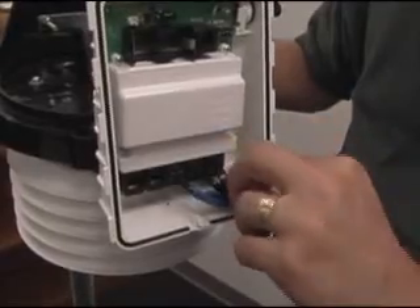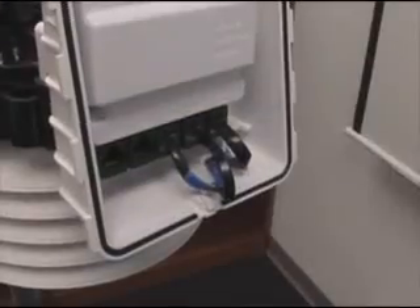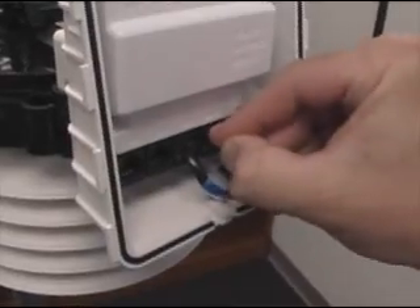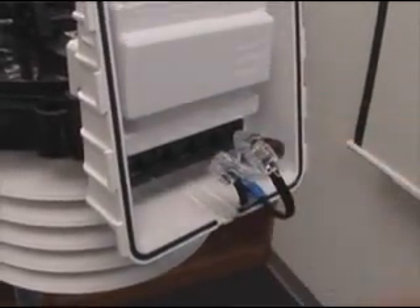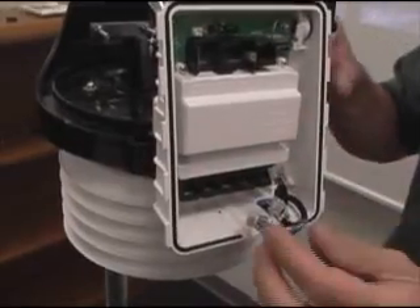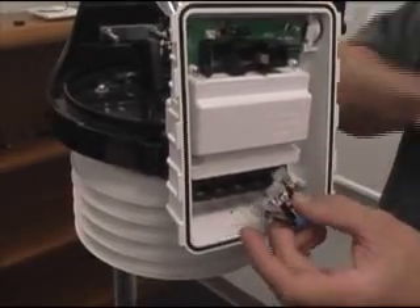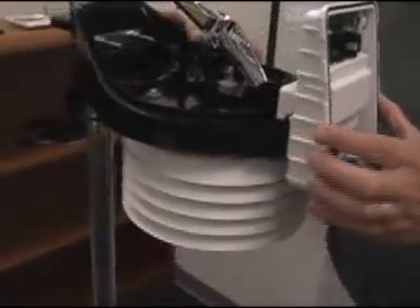Down here we have the small foam — you need to grab it with your fingers or use some needle nose pliers. Then unplug each of the sensor cables. Once they're removed, you can unlock the box. We'll pull the cables out once we have the box off. You want to be careful of the tabs on the phone jacks when you pull them through the hole — they're breakable, so be very careful.